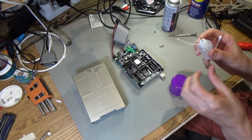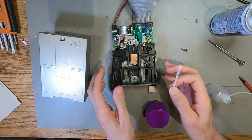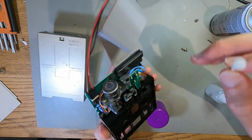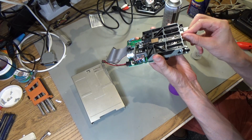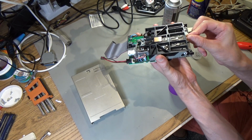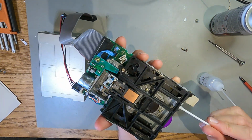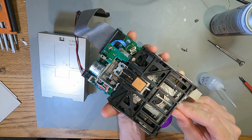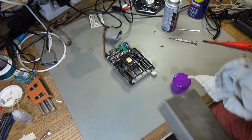I'm so gutted about the retrobrighting getting botched up. This computer was basically perfect when I got it. Well, I'll say perfect. It was pretty grubby. Let's just see if I can clean these heads. I'm just using a bit of alcohol to clean the heads. Everything else looks all right, I think. Well, actually the heads were probably all right as well. I'm just making sure there's none of that dust on them. Let's give this top a clean.